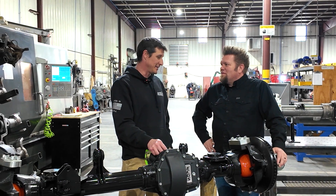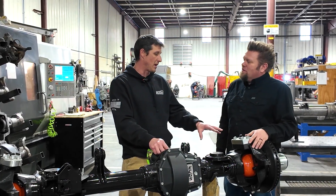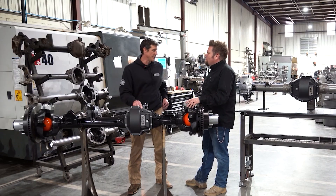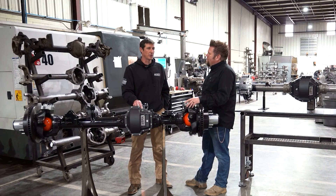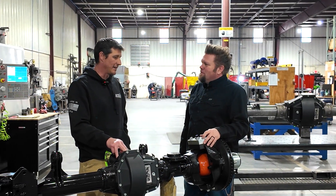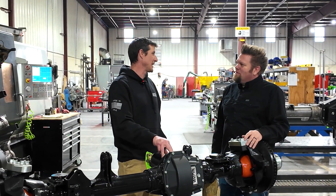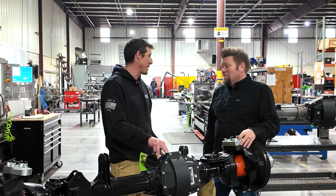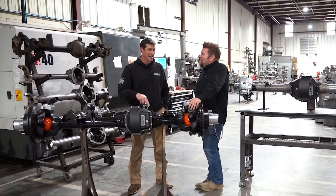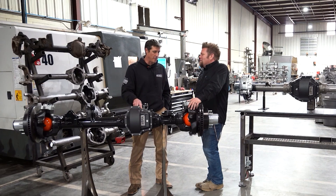If that isn't strong enough — because once you go to this wheel-end kit and go to 40 spline, your ring and pinion is going to be your weak link. So when you start talking about buggy, rock crawler type stuff, high pinion 60 probably isn't going to get it done. That's usually an attrition game where it'll get it done for the first few months or first few runs, but after multiple shock load after shock load, you'll end up having ring and pinion failure.